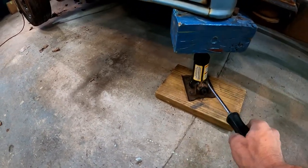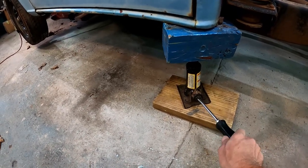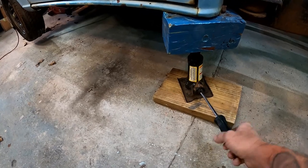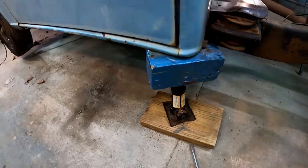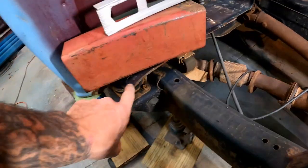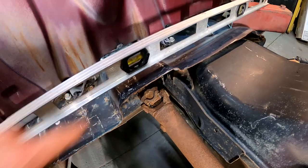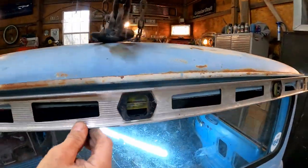All these little twisty jacks here — I always save these anytime I can find one. These come in handy. I've got one set up on each corner on the rear and we're just going to jack it up just slightly till we get it level. The rear is just slightly down in the back — I'm talking maybe a quarter-inch, half-inch tops. I'll go over to the other side and work it up as well, work it out at the same time till we get it level. I put these right on top of the cab where the cab mounts are on both sides to space it up over the driveshaft tunnel, and we're showing level in the middle. Threw the level up under the drip rail and we're showing level there — I think we're good.